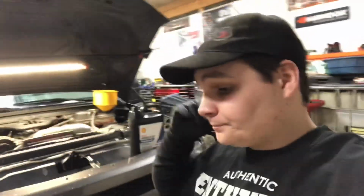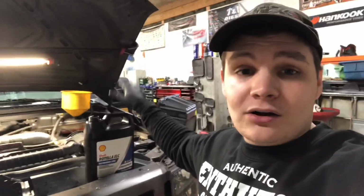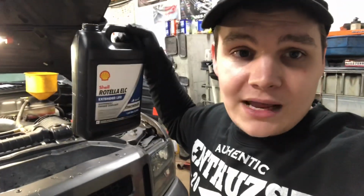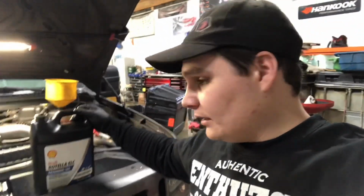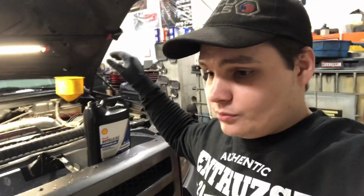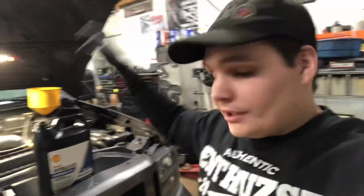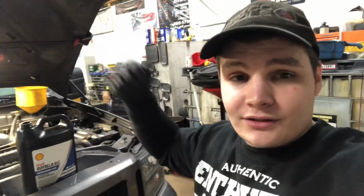So, short video here. Hopefully you guys enjoyed it. We're gonna get the coolant topped back off. I always recommend red ELC for your coolant. You guys can look it up on the forums and stuff. Everybody says red ELC is the way to go, so that's what we run. We're gonna get it topped off, and the tow truck's good to go.